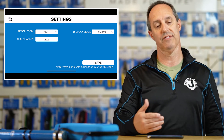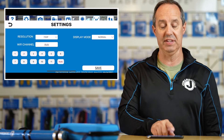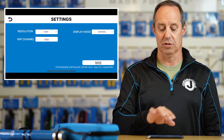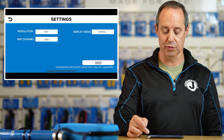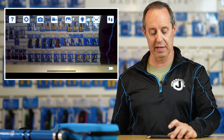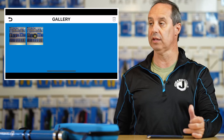In settings, you can change the camera resolution from high-res 720p to low-res 360p — you might want to do this so it doesn't take up as much memory. Next is the Wi-Fi channel; press that and you have 11 different channels to choose from, or auto. It defaults to auto, but in a very noisy environment you may want to try other channels to get a better image from the camera. The orientation options are normal, always-up round, or always-up full screen — the default is always-up full screen. Once you make your changes, just select save. The next icon is the camera — to take a picture, simply press the icon button. The next is video — press the video button and it'll take a video; press it again to stop. The next is your gallery, so you can go in and see anything you may have recorded.